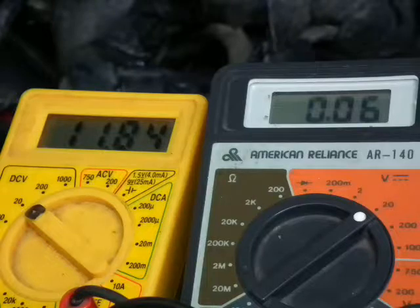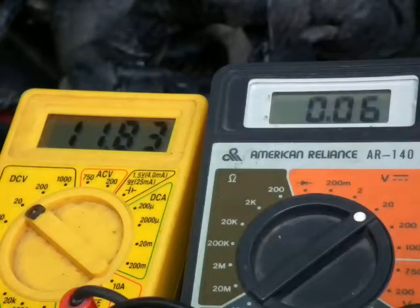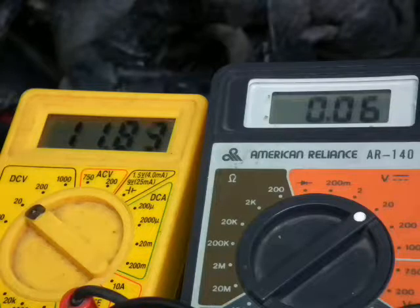I am NOT getting the 10 volts which a lot of people say you need, and mine will still start without the 10 volts. That was the main purpose of this video — also to tell people: if you're getting a crank but no start, no spark, check your voltages.